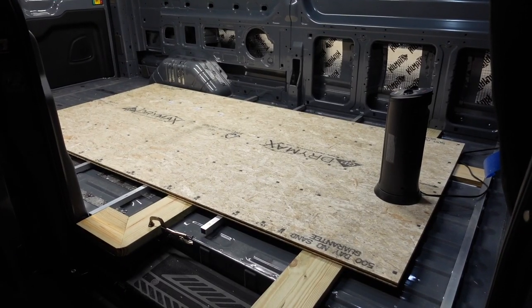We let it dry. Continuing on with the floor project - we've got all of the one by aluminum bonded to the floor using 3M5200. We also planed down two by six treated lumber that we're going to use underneath the cabinets and the mounting points for the extruded aluminum. That way we get a better mount than into the square tube aluminum by itself.